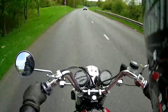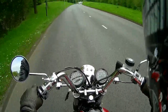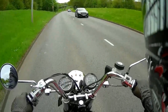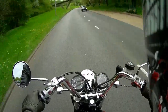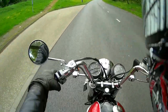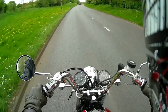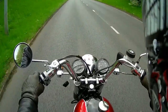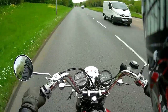While doing that I put a new clutch lifter in and also rerouted the cable. The biggest thing I noticed straight away is how smooth this 7 plate clutch is compared to the 6 plates. Pulling away it doesn't want to judder, it doesn't want to grab - it just pulls away really smoothly, which is quite amazing really from what it was.